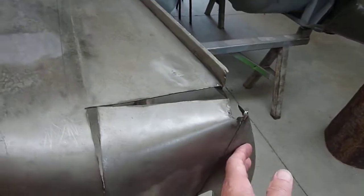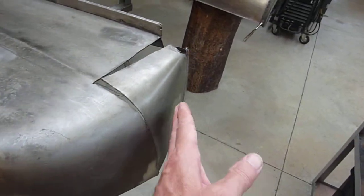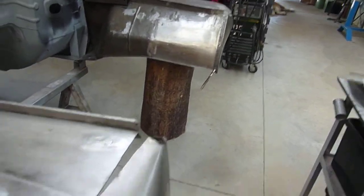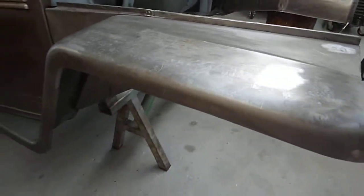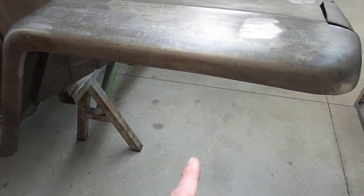On what they call the pointy nose, it comes up and then goes all the way back — so it comes forward as part of the pointy nose, as well as the grille going back and forward. By pulling that forward I get the room I need between the radiator and the front of the engine without altering the centerline of the axle in relationship to the guard.